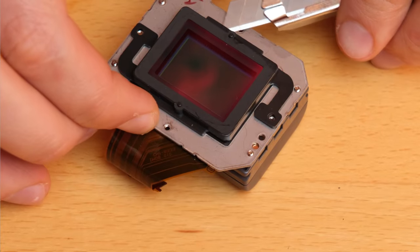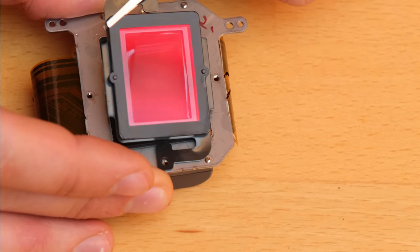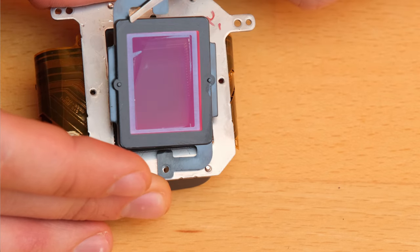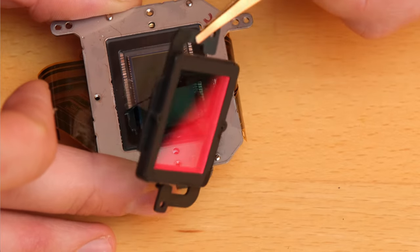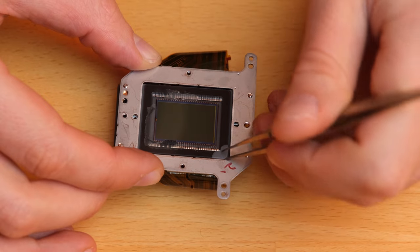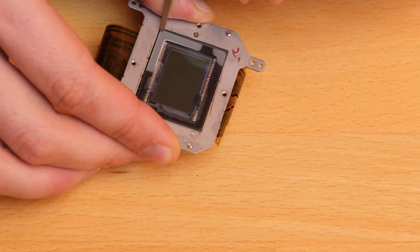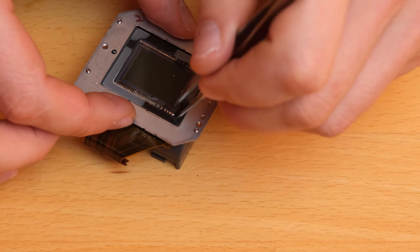Also, don't throw away the piece of foil or any other component that we've taken off — we do have to put them back on later. If we don't put them on, then the height of the sensor changes and our autofocus point will not be correct anymore. And while we can calibrate the autofocus point, the calibration only involves tiny changes. If, for example, you leave out the infrared blocker, then the sensor will be far away from the focus point, and that can't be corrected with the autofocus calibration. Before we can access the sensor, we need to remove one last piece of glass that's there to protect it. It does come off easily — I just used the tweezers — but unfortunately I wasn't careful enough and I broke off one of the corners. Luckily, it's not visible on images.